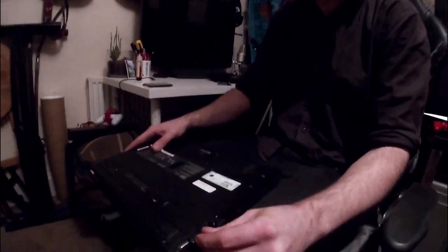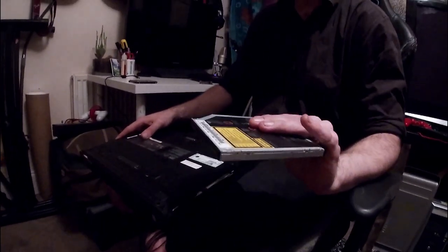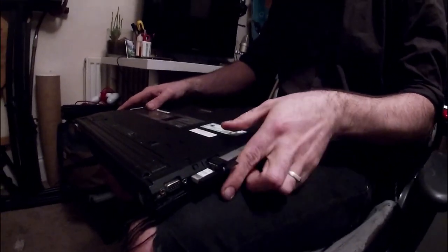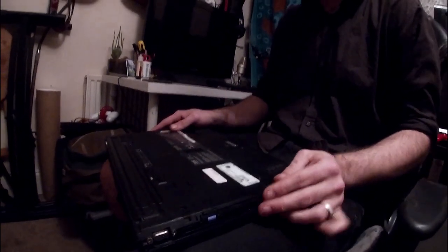The only real fault with it is obviously the battery is a bit dead. It still charges and holds charge, but only for about 20 minutes. And the DVD drive, which is removable, so I intend to replace it in the next video, spins up, but then it doesn't actually recognize the drive, and you can't boot off it. So that's the only real issues with it, other than slightly cosmetic stuff. So I'll be back after rolling the titles with the breakdown and what I did to get this working.